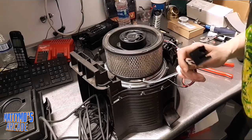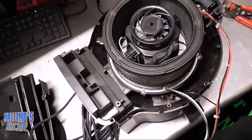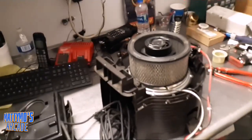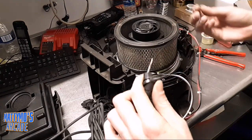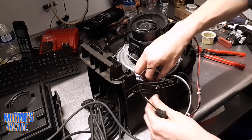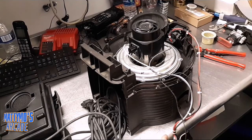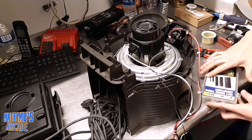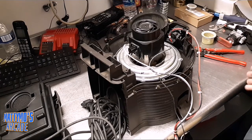Where do I plug this in? There is a spot — down in here, right there — that's where the ground was plugged in for that part. A little different than the other vacuum. So I'm going to take this guy and plug it in down here. Make sure you don't pop that off first; it'll be a little easier to get to. So we're grounded now. Let me go ahead and get some heat shrink out — I'm not going to worry about soldering it. It's going to be buried inside this thing, so I'm not worried about it being under stress.